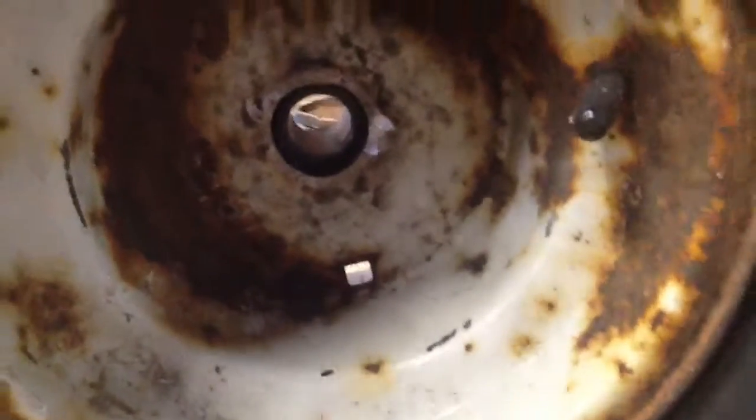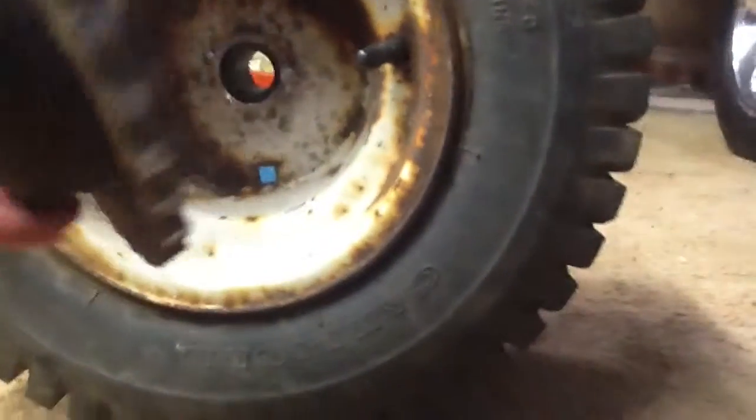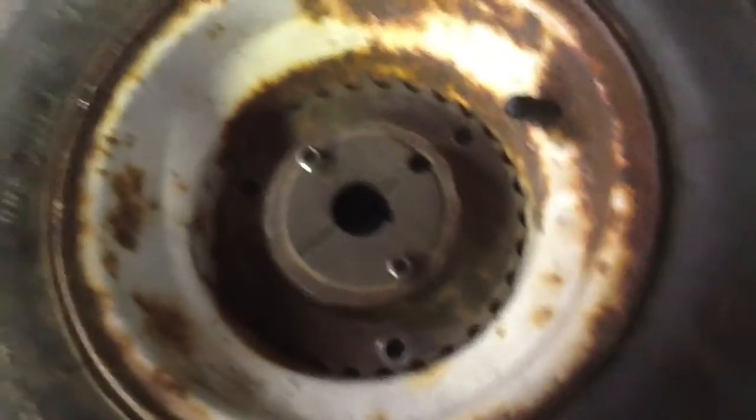What we're going to do is get something like this — like a sprocket. We ground down the teeth on it and it will slide on the shaft, on a one inch shaft, and on the wheel. It'll go in like that, and I'll weld it all the way around. That will be our hub so we can bolt these wheels to the axle.